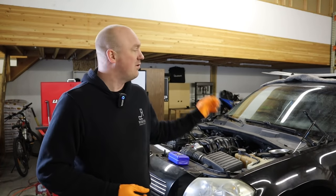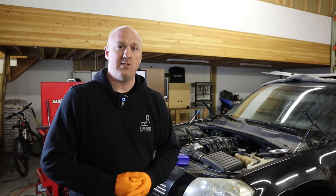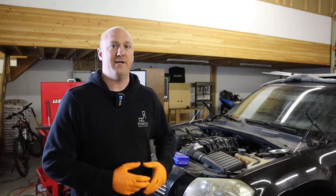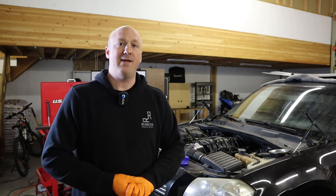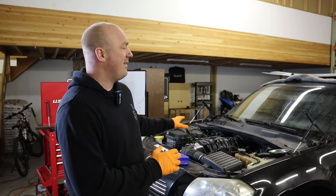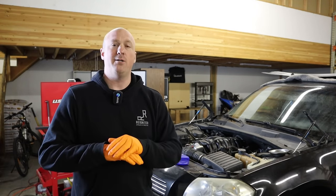Because I have a brand new oil pump in there, I don't want to fire it up completely dry — I'll pull the fuel pump fuse and crank it over for at least a minute in intermittent cycles so I don't overheat the starter, just to prime the system first. I'm also going to fire it up, get it fully to operating temperature, and let it cool back down before looking at any data — I don't want the numbers skewed in any way. I want everything to be just like it was for the previous test, so I'll run the thing to temp, then let it cool, and then run the tests.